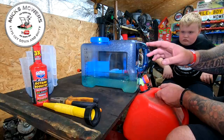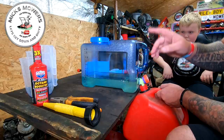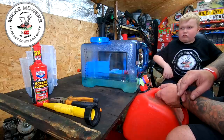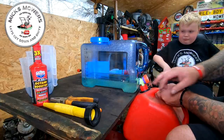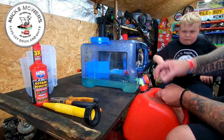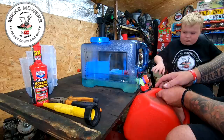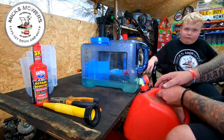You can see I've literally got every single drop of ethanol and water out of this product. As you fill your can with the clean fuel, the very last bit — if it's got any water content — you can either discard it or pour it into a jug and tip it out so you get all of it out completely. I'm going to drain three quarters of it out — there's just a few drops of water, nothing special.